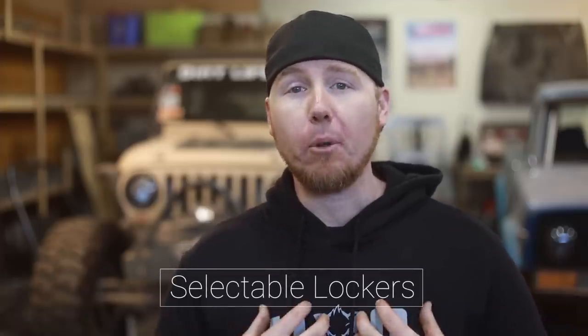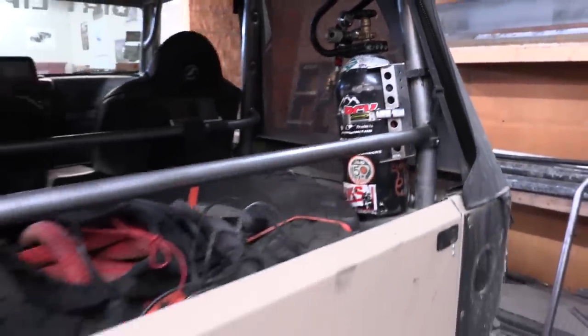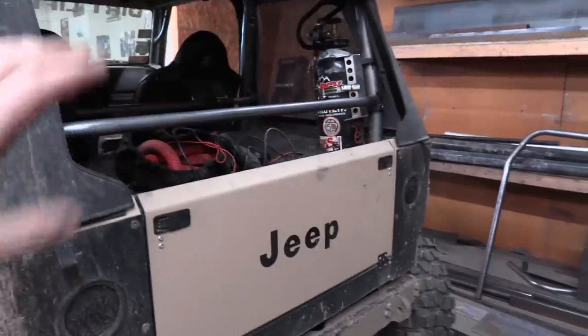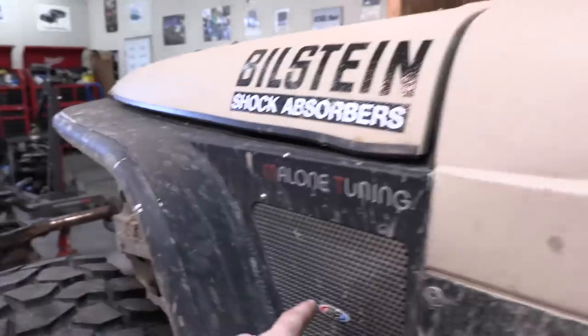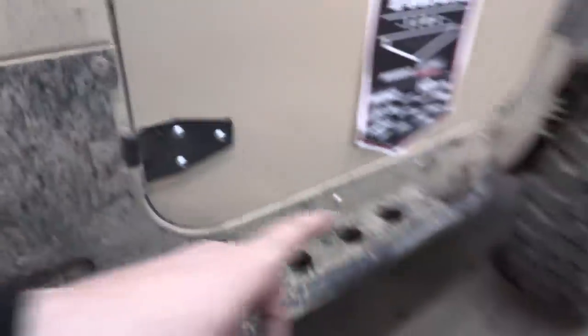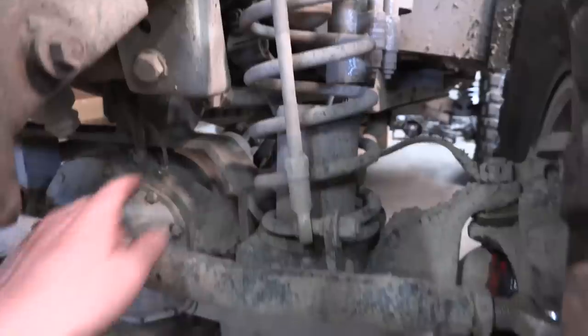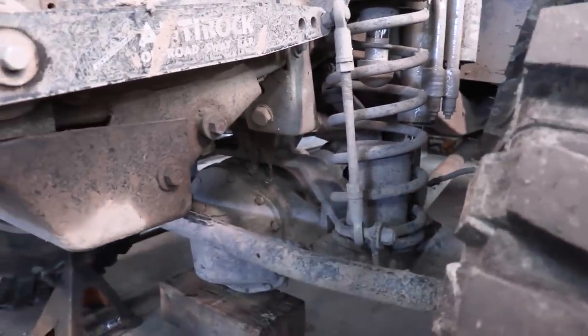The last category is selectable lockers. I personally really like air lockers — I've had pretty good luck with them over the years. On the good side, you can select when you have traction and when you don't, so you can turn the locker off, turn very easily on the street or off-road, and then whenever you need it, flip the locker on and it acts just like a spool. On the downside, you need a 12-volt power source and you need air. My air lockers are fed by a CO2 tank — it's very reliable: when it's empty, it's empty; when it's full, it's full. There's no electrical going on with the air source, but it has to travel through a nylon line under the cab to two solenoids. The two solenoids are fed by one airline, and one solenoid actuates the front locker and one actuates the rear locker via an electric switch.